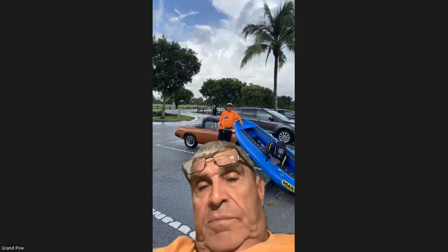And since I have you at the same time, I do have another issue with the speedometer. When I turn the ignition switch on, everything is sporadic. The needle buries itself into the red zone, all the way down to the extreme red zone. The tachometer you're talking about. Yes. And then after I'm driving down the road a while, it'll fluctuate back and forth, then drop to 1,000 RPM or 1,500, whatever gear I'm in.